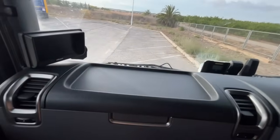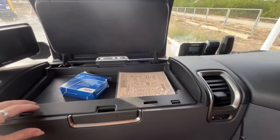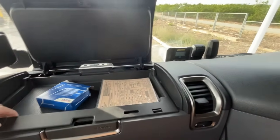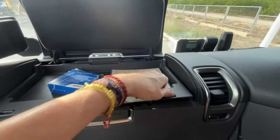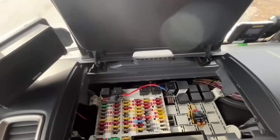If you've got a bit of common sense, most of these jobs aren't difficult. Changing bulbs, checking basic wiring. So I've checked what's wrong and now we always do the simple things first. The simplest thing is to check the fuse. In the Scania the fuse box is under here — just unclip that, like that, and there are your fuses. They're generally in the dash almost.